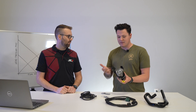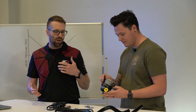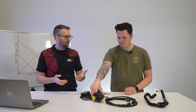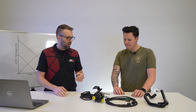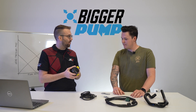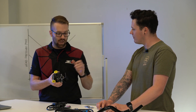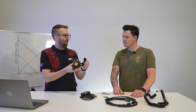So, how does it provide more cooling flow? Nissan saw the benefit of more flow because on the Red Sports, which make more power, they have two coolant pumps instead of one, like the non-Red Sports. This pump is a much bigger pump than the factory pumps. If you have a non-Red Sport, you will keep your existing pump and add this as a secondary pump. If you have a Red Sport, you'll replace your secondary pump with this one.